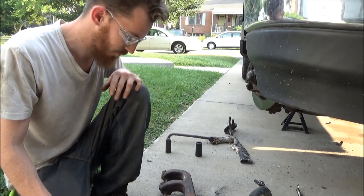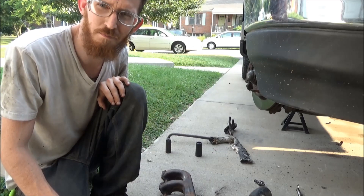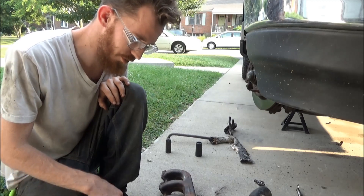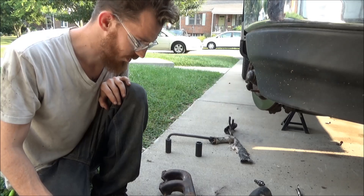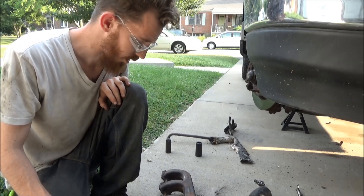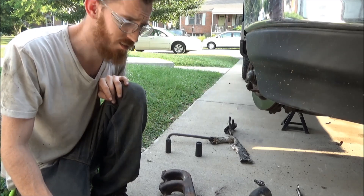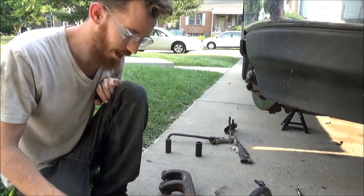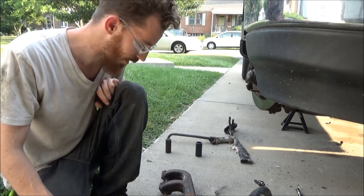That's all it's going to take. If this doesn't work, what I would do is get out the torch again and heat it up, then go ahead with the impact. Sometimes you go back and forth — forward, reverse, forward, reverse. Eventually once it starts moving it starts going, and I've never really had a problem where I couldn't get anything out like that. I don't have the strongest impact in the world — it's not like an air impact or a new titanium or anything like that — but I've had success with that.